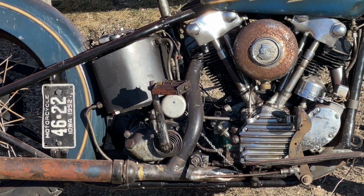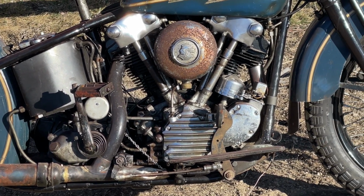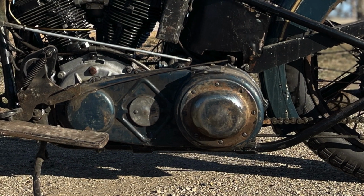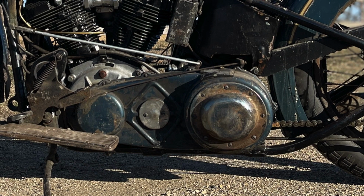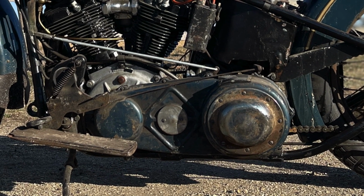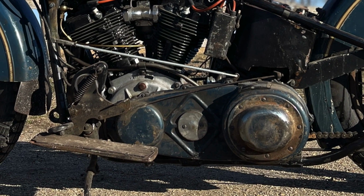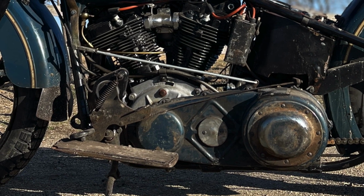The additional feature that Harley incorporated in '38, riveting a little stamped steel plate on the inside that would catch oil from the spinning main shaft and direct it down onto the throwout bearing to make it last longer and live happier. The clutch discs were modernized by eliminating individual steel and fiber plates and incorporating 2 steel plates with fibers riveted to each side. Fewer moving parts means fewer pieces to gum up and to service.